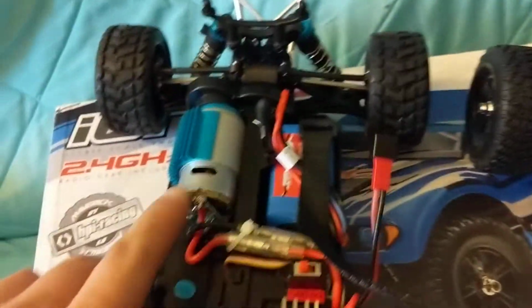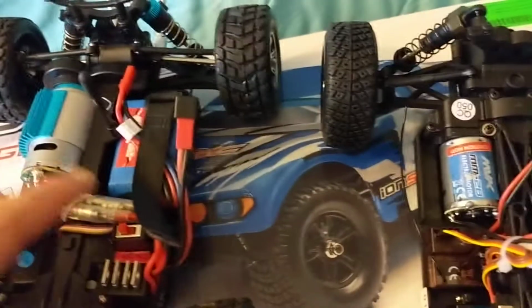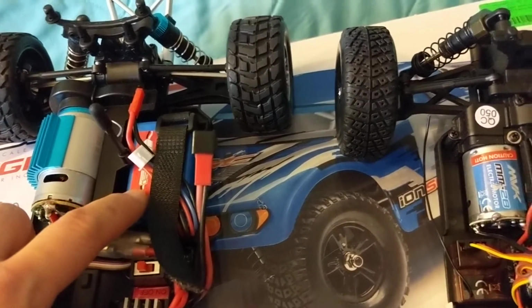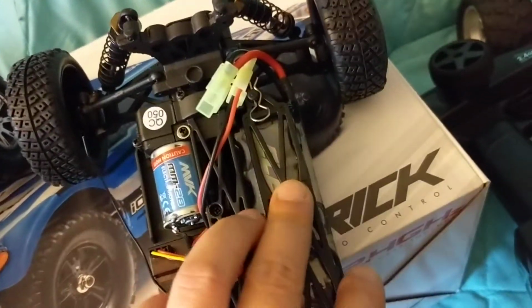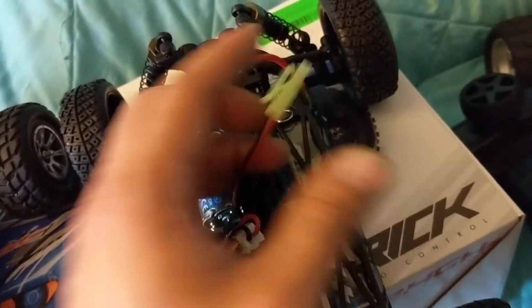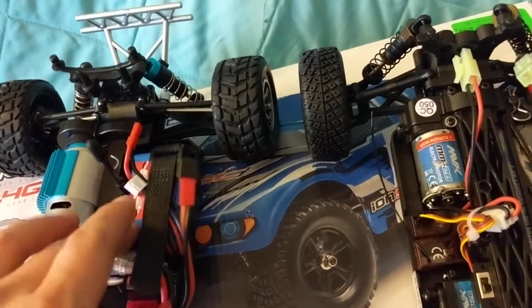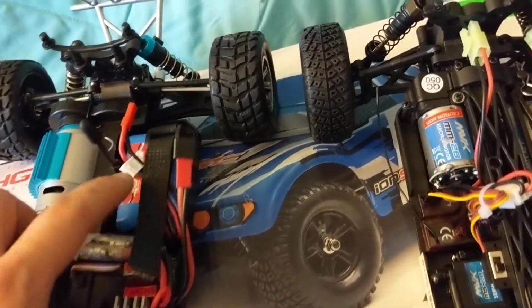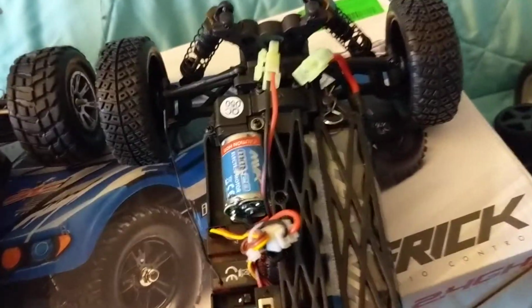Getting back to that, definitely power motor goes to the Wltoys, as well as the battery, because this is a 7.4 LiPo battery, a JST connector, versus this 7.2 volt NiMH battery with the mini Tamiya. So juice, you'll definitely get more punch out of the LiPo, and I do use upgraded batteries on these to give it even more extra punch. But the alternative to this, I'll get to that in a little bit, but sorry for all the rambling.